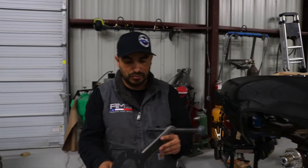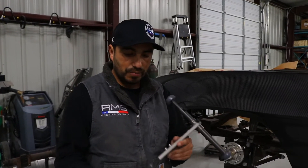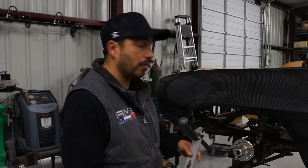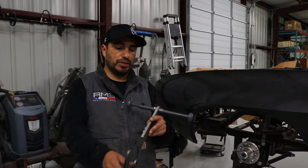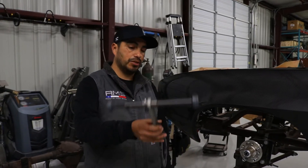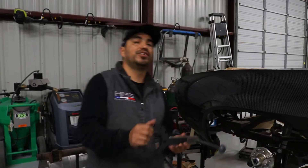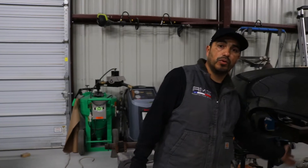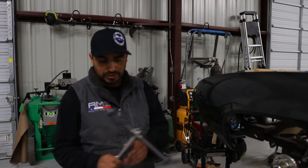When you're looking to see what size tire you can run on your front or rear suspension, you set this tool up and you can actually spin it. This will let you see the clearance you have before you hit the inner wheel well on your turn radius, and before you hit the lip on the outer fender.